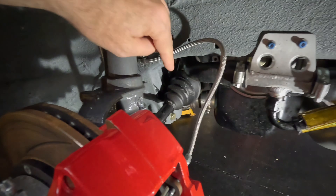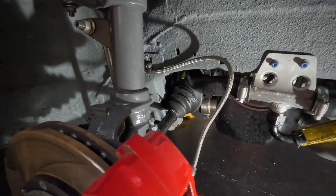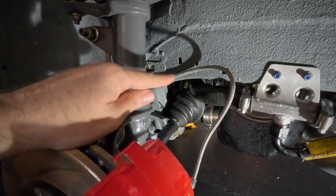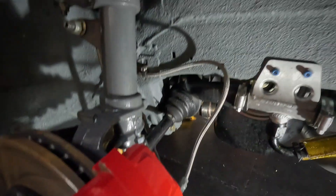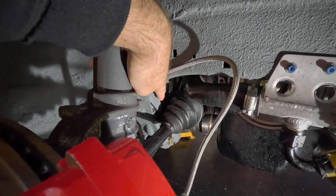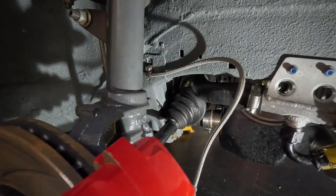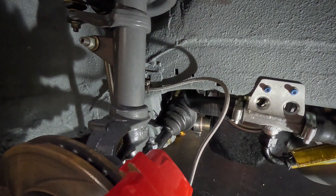If you remember back to the last episode, I showed you that I had split my CV boot and it has spat grease out everywhere, so I've got a cleaning up job to do. But the added bonus of this kit is that it moves the CV joint further inwards, and that's how it achieves the equal length driveshaft — because it moves the bearing carrier further inwards and lengthens this shaft to be the same as the passenger side. I will also no longer have a clearance issue. It also gives you better CV angles and, if you're doing things like rallying, this kit gives you more droop travel if that's what you're after.